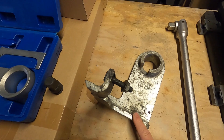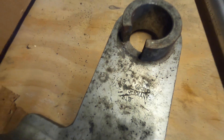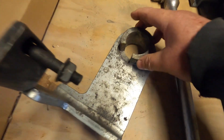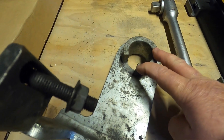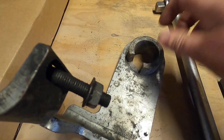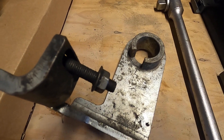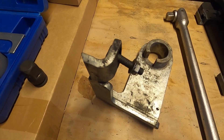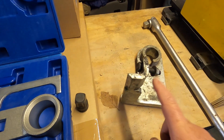I've managed to borrow a VW tool — this is the official VW locking tool. It has a small little recess in it which fits into the crankshaft pulley, locks it in place, so that you can use a 27mm socket in there to loosen the crankshaft pulley bolt, which is done up very, very tightly — so much so that my 400 newton meter impact wrench will not budge it at the moment.